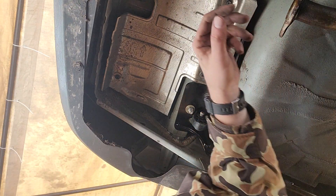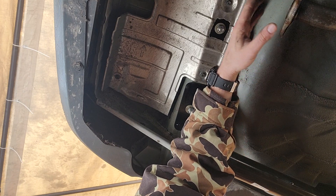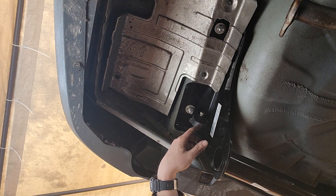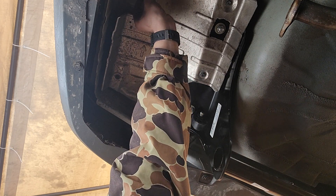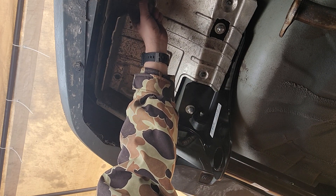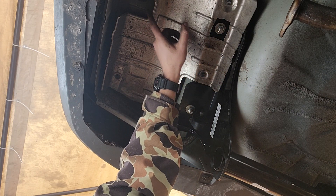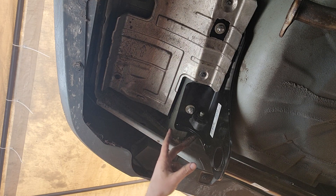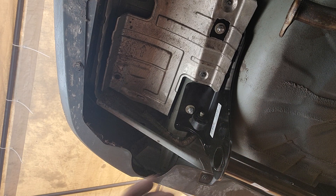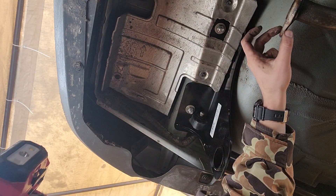For our muffler, I got the intake right here and the exhaust pipe that goes to the car. You get your rubber hanging bushing here — this one is more towards the outside of the car. I took it out right after I got the bolts loose from the muffler, slid it off that one and then off this one last. So we'll do the same in reverse: put that on first, then slide it in second, and then tighten our bolts.